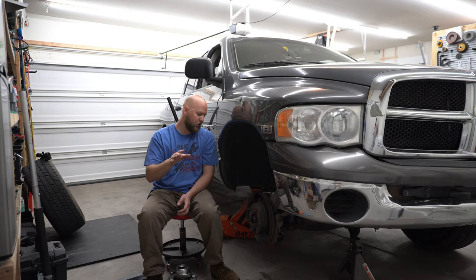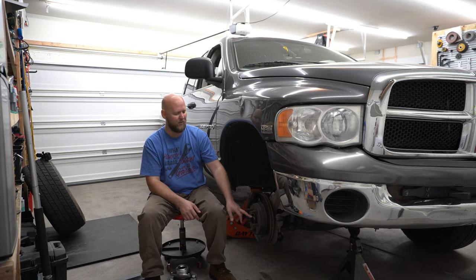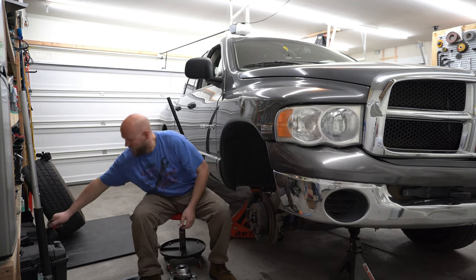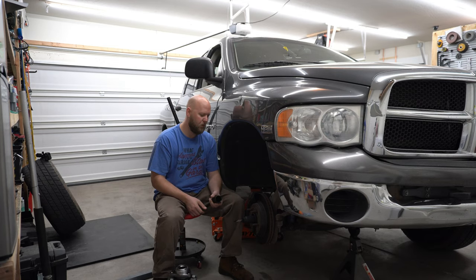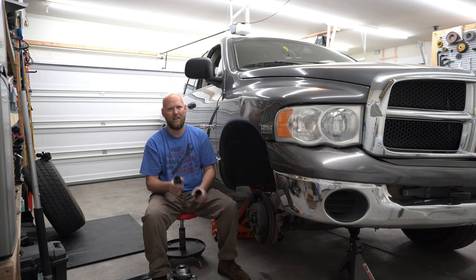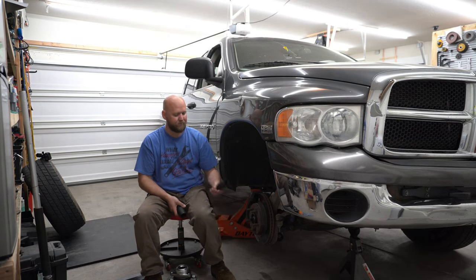So that's what we're doing — we're gonna go ahead and get started. A quick note: I looked online to see what size axle nut I need for this truck and every other link I clicked on alternated between saying a 35 and a 36. So I bought one of each. This one fits the 35. I got the six-sided socket — I didn't get the 12-point. It's just not as strong. With the six-sided you get a lot more surface area when you're sitting there ripping on it trying to break it loose. So mine is indeed a 35. Let's go.